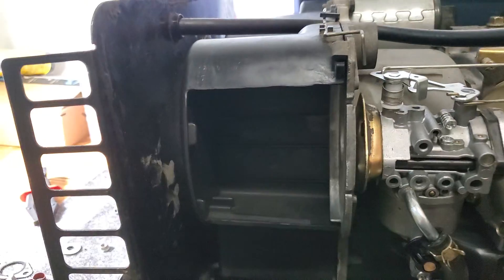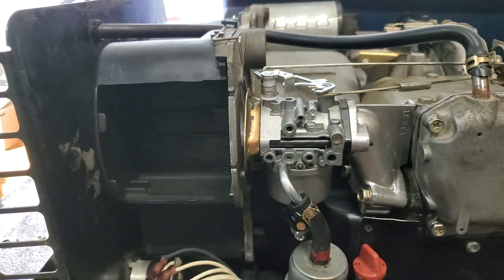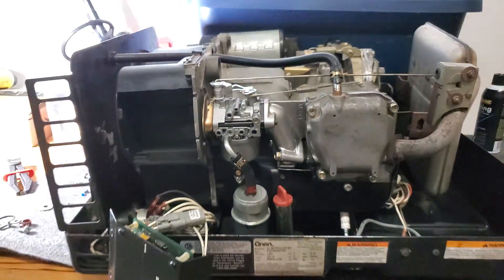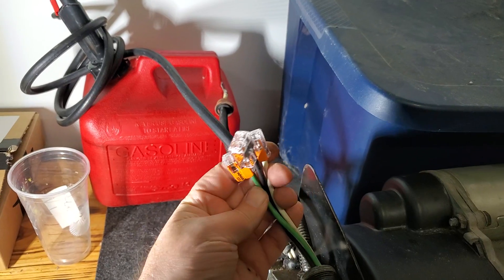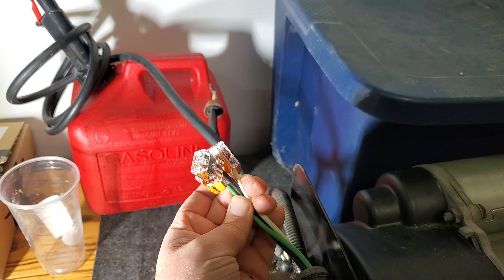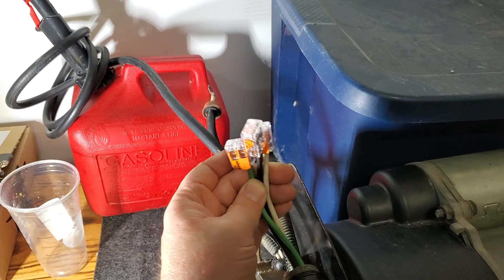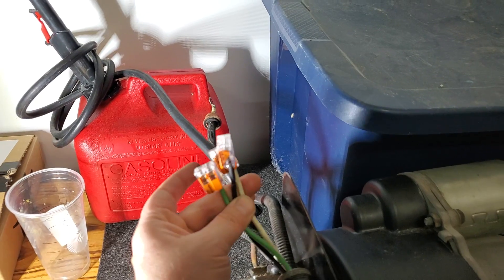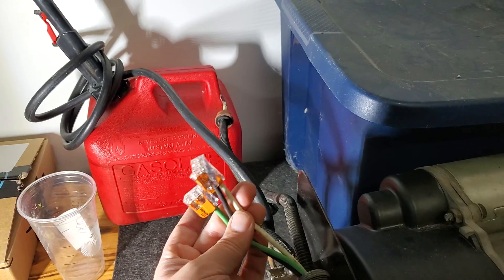There's the air filter, which I've removed, and a retainer — a piece of wire that holds it in. That's the only thing I've taken off this whole thing. Right now I'm setting up the 110-volt output: I've added lever nuts so I can leave a multimeter connected and observe whether voltage is coming out. You start it up using the starter motor, compare your black and white wires, and look for a voltage developing to confirm it's producing power.